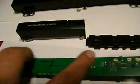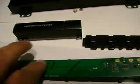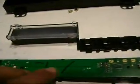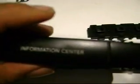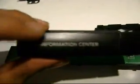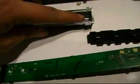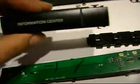Also, if you notice, this section right here is pretty much blank. There are no components or anything soldered on it, so nothing to worry about. You can position the LED right in the middle. Another thing you need to pay attention to is, even if you put the LED in the center and you place this thing all back together, the way the light is going to hit these 2 words, part of like information, wherever the LED hits, the letters will be more shiny than the other part. So to help solve this, you can place in 3 or 4 white pieces of paper right here, and once the light hits the papers, it's going to equally spread the light across all the section.